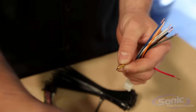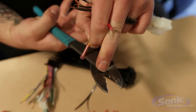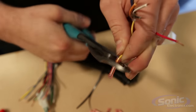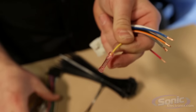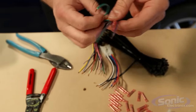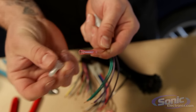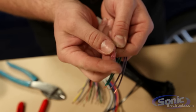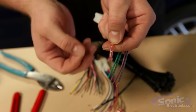After twisting the wire, take your butt connector and set it on the wire. The crimps have a nice little V-groove with a tooth for the butt connector — slide it in and crimp. Now if we have any leftover wires where the colors don't match up, we just terminate the end with a butt connector or a crimp cap to cap off the wire. The reason is we don't want any bare wires inside the dash shorting out — even a cut wire could short out, and fixing that later is a pain.